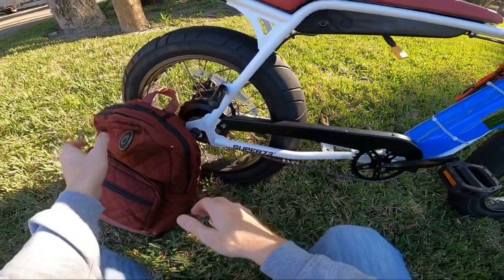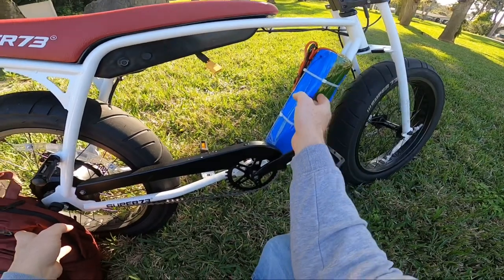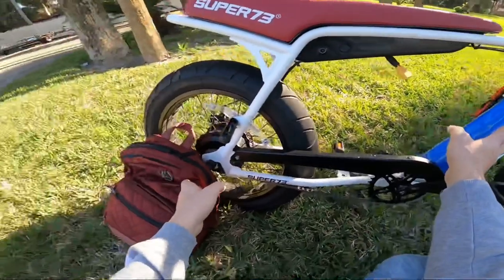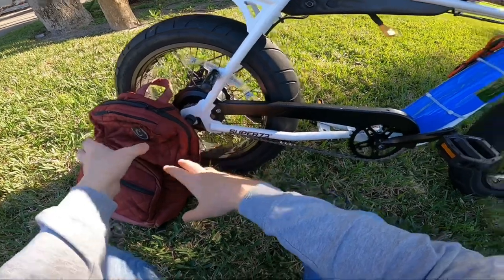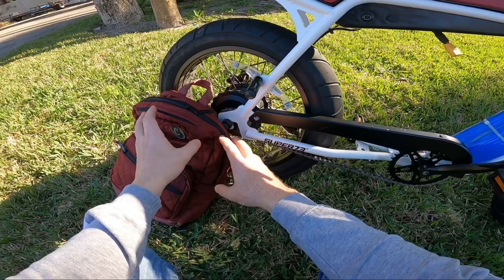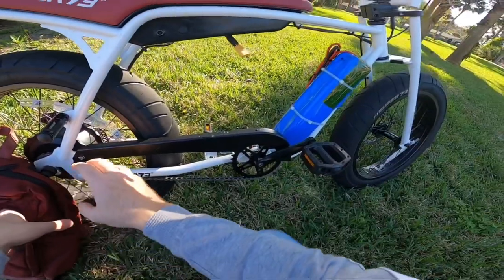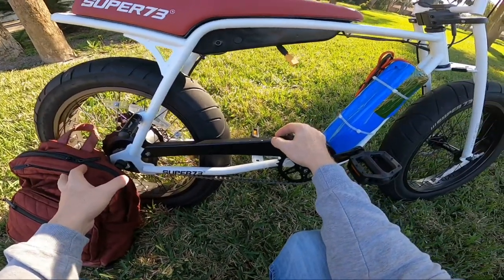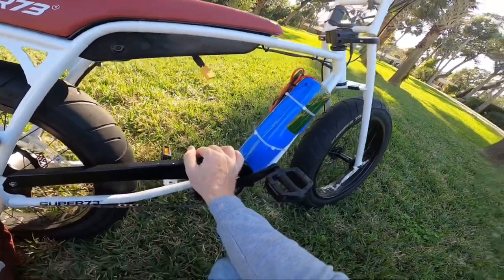So what we're going to test today is, this is a 30 amp limited from the BMS 20S, so 72 volt battery, fully charged, 84, we'll check that, versus a 52 volt battery that's fully charged at 58 volts. This has a 50 amp BMS, so technically we should see more torque, less top speed, and less torque, more top speed. If you do the math though, the end equation ends up roughly about the same for the wattage, and I'll put that math in the description.